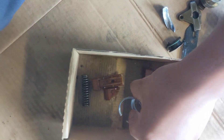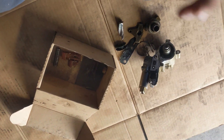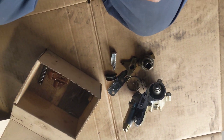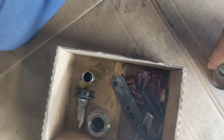Now the one thing I want to talk about is that all the debris that falls off from the tensioner goes all the way down to the oil pan, and that is going to cause the oil pump to get clogged up. I don't have the debris that I pulled out of the oil pump strainer on hand to show.